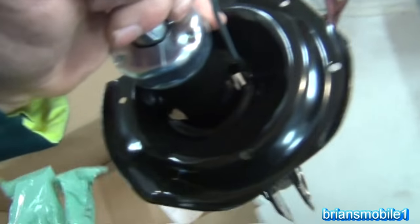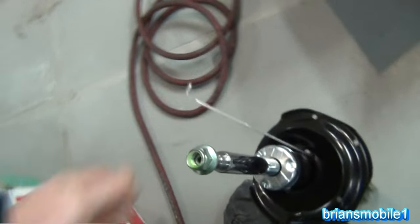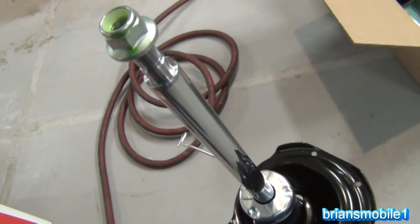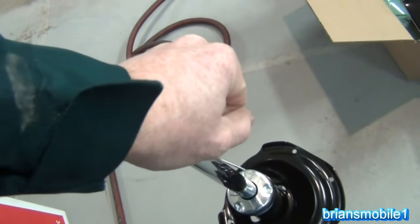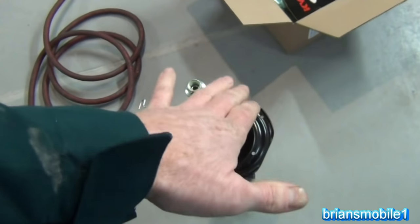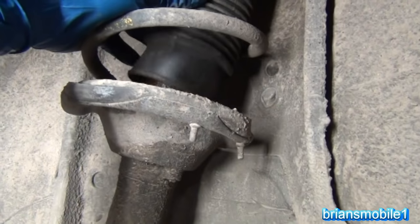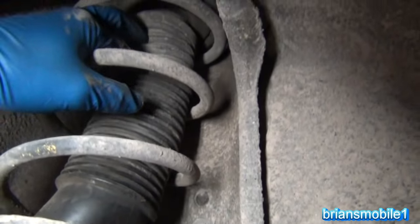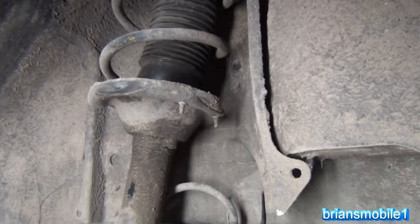So here's what happens when you go to get a new strut. You take it out, get this little wire to release, and watch what it does — can you see how that's getting longer? So that's the gas charge of the strut, and that gives a little bit of support. When you push down you can feel how much support's there. Once that gas charge is gone from a leaky strut, your car is not sitting right. These universal boots just did not do the job to keep all the crud out, so when we put the new struts on we're gonna make sure to replace these.